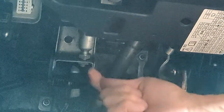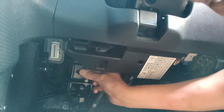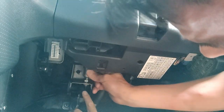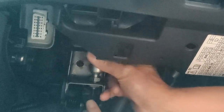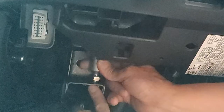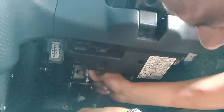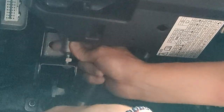What I'm looking for is to get that plunger further up towards the steering wheel in that direction, so that I have to lift the clutch up further. Hopefully that means I'm not going to stall it as much - that's the plan. I know where it is at the moment, so I'm going to count the number of turns so I don't muck it up. One, two, three, four, five. There's a threaded nut but the nut is actually welded to the bracket, so now the clutch has to be higher up and would engage when I raise my foot higher.